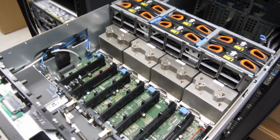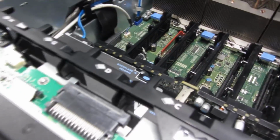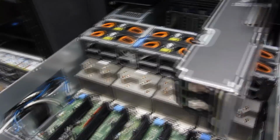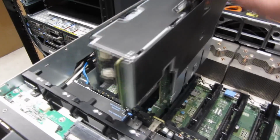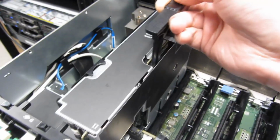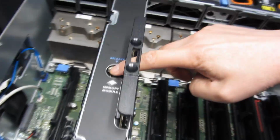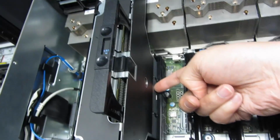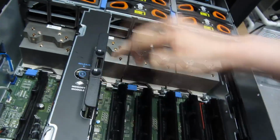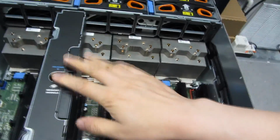Now, as I had mentioned previously with the memory modules, again, notice the notches. So there's a notch right there, and there's a particular notch right there. And so this here is actually seated based on those notches. So I'm basically pushing it down. Now, once again, if I have trouble seating it, I want to push the release so that this bottom thing here is not jammed. So I'm pushing down and hearing the click. And once I'm able to push that down, that's all set.